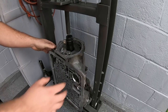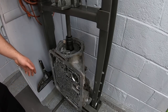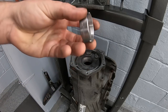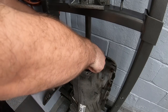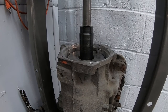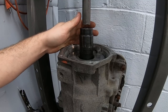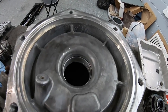You don't need a press for this, but if you have it, why not use it? Look how easy. Here's the new bushing - one thing to know when putting it in is you want the two notches facing down into the case. You can see the shiny clean spot where the old bushing was sitting, and I'm just trying to get it to cover that up. That looks perfect.